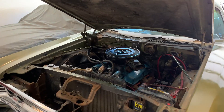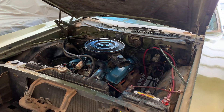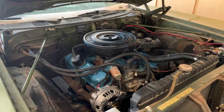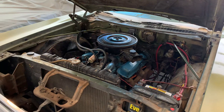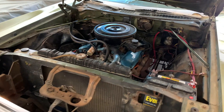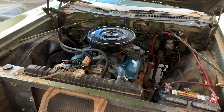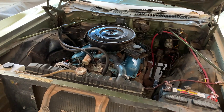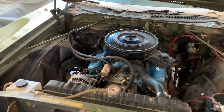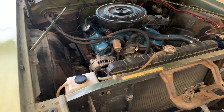After using everything that I could to try to get this back together, I checked for leaks and was able to try to dial the motor back in timing wise, but I was finding that it wasn't really advancing the timing as well as it did in my truck. That was making me scratch my head. Looking back at the first video, you can audibly hear a little bit of a rattling noise briefly when I start the motor up after re-gapping the points. I was thinking it was a timing chain — and sure enough, that's exactly what it was.